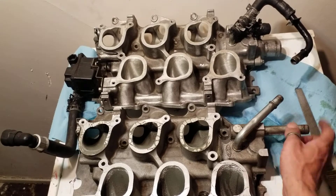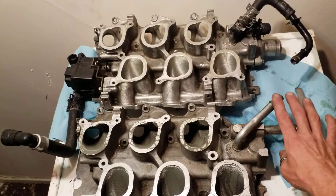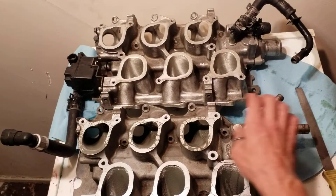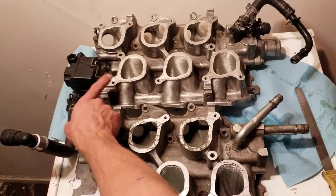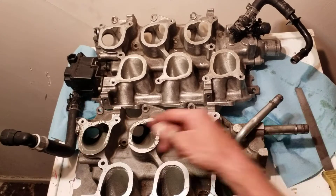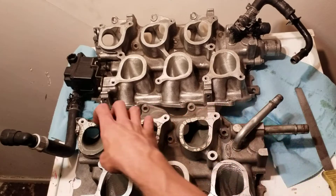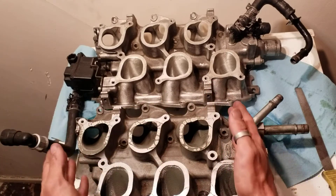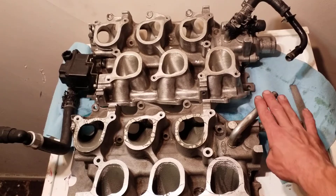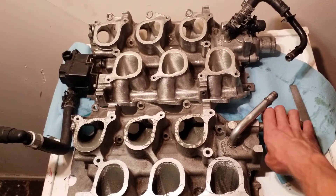So you could come out of this, but that's the reason why optimally, by design, you're going to want to take this non-pressurized one out. You're relieving the flow and actually allowing what would be this part of the design to get that flow coming out of the front. It's actually evening out the lower intake for the Mustang design by utilizing this outlet for the water pump rather than this one.